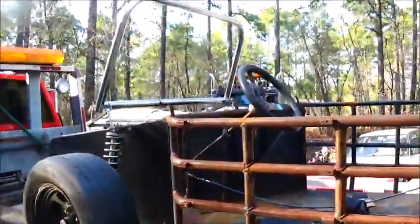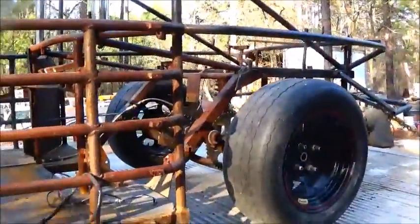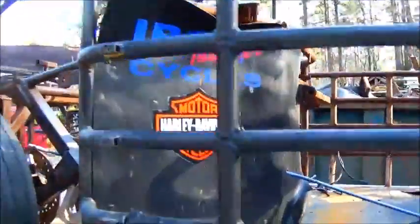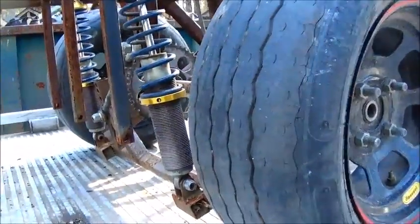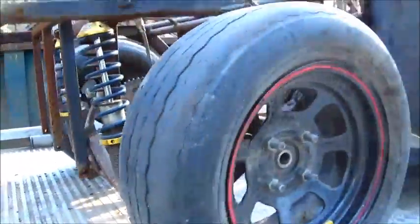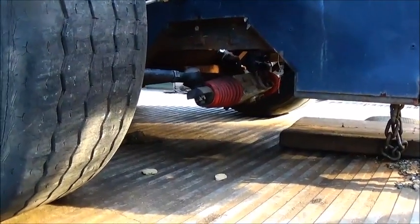Okay folks, we're back with this thing. Johnny had added that chrome windshield frame and that loop right there - they weren't on it originally. It had some kind of sheet metal over it and supposedly a Harley Davidson engine. It does have a sticker - Iron Thunder Cycles. Front coilovers, rear coilovers, fully adjustable. Looks like they've got them adjusted up high, but you can change your springs. It's got a really nice set of stainless brake lines that we may use, and the panhard bar - we'll take it off and use it. It's got an aftermarket rack on it that I'll have to check on.